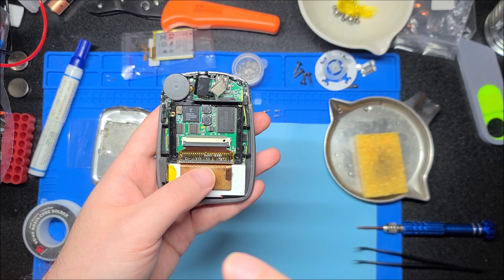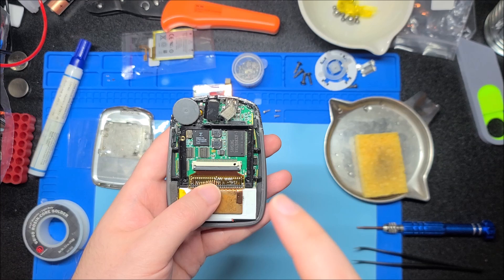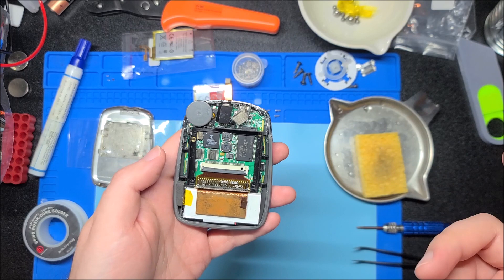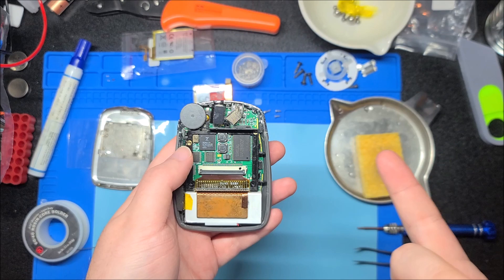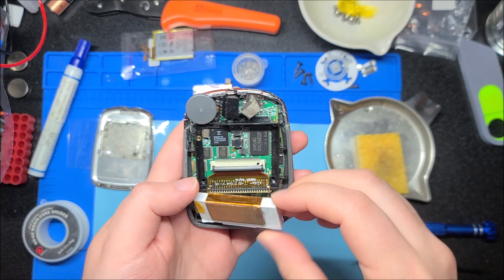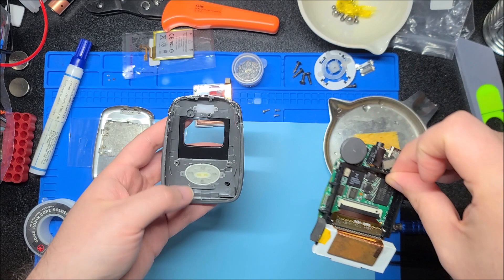From what I read in a forum post, it's actually really interesting why this will only work with specific cards. It uses a very specific sleep mode on these cards, so if the card doesn't support that sleep command when the board issues it during shutdown, it crashes — it locks up the card because it's an unsupported command. It'll look like it's working with any card, but yeah, it definitely has some issues still.